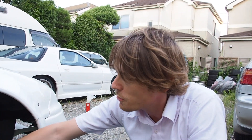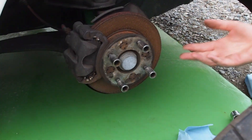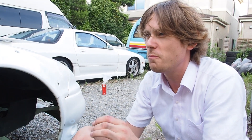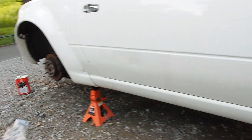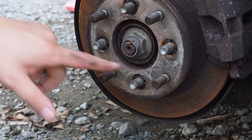So we're going to have to work with these spacers. This is a 114.3 bolt pattern, so the idea is to get a set of wheels that are 114.3 by four bolt. But come back to this one over here — we can't help the fact that we now have eight holes.